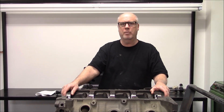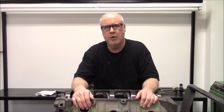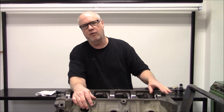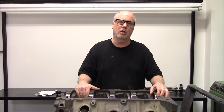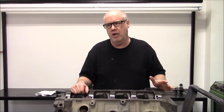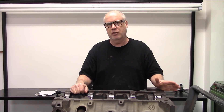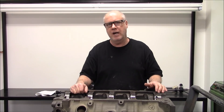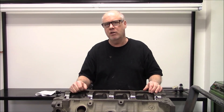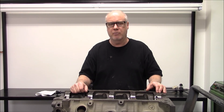So first let's talk about the block castings. The main blocks we use in my shop are a 289 casting, a 959, and a 445. You also have your 512 and the 427 blocks earlier in the run, but those aren't mainstream so we don't have a lot of experience with the cam tunnel on those. The 289 casting and the 959 are the two problem children usually. The 445 block — the cam tunnel is usually fairly close to being within spec.